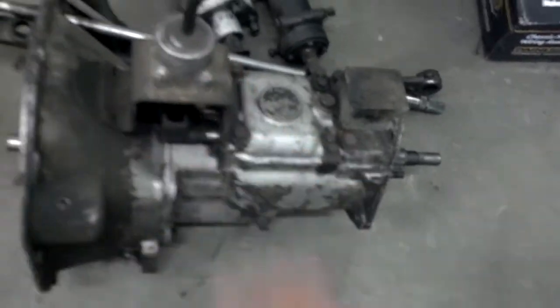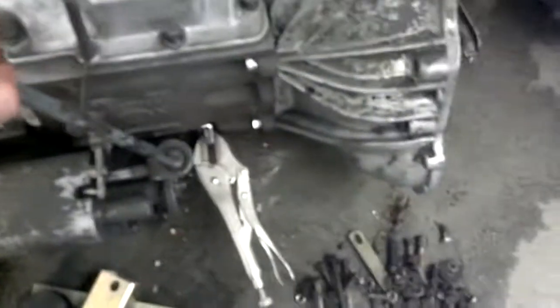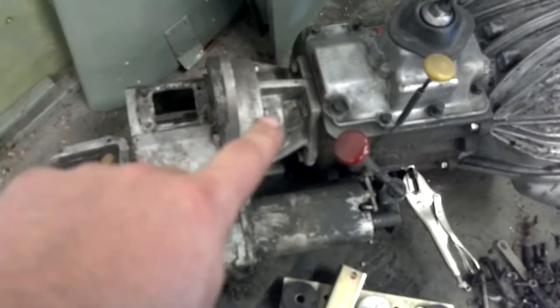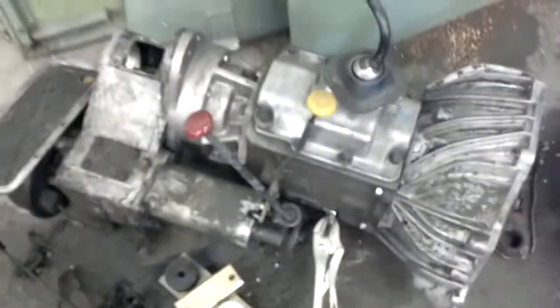Here's what's basically going to be going on. If you take a look at the length of this — my hand in here is a frame of reference — I can almost span all but about six inches of the original transmission. When you look at what's coming in, the size of the bell housing is much different. The advanced adapter piece takes me from an NP-435 out of an 89 Bronco, with a bell housing to accommodate the 302 engine, to the original transfer case, which is mounted to two adapter pieces. There's one, and then a second one that just gets you the upper lip.